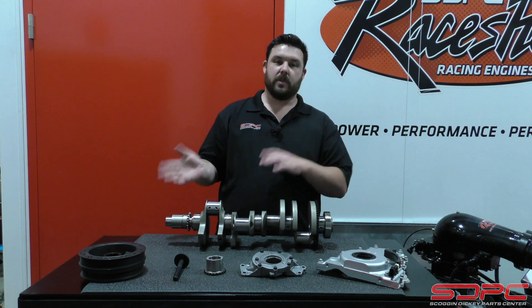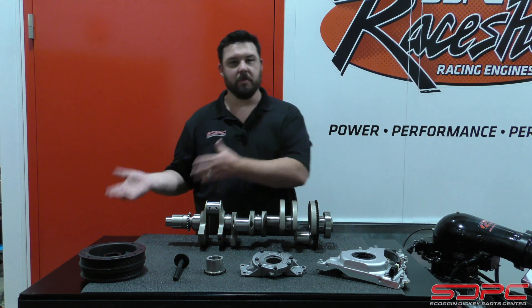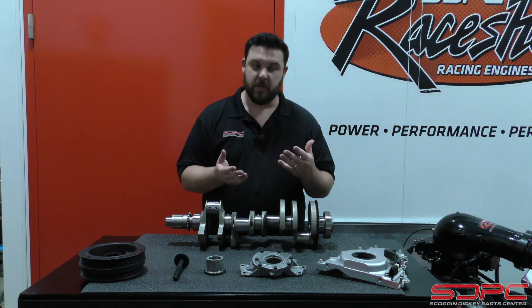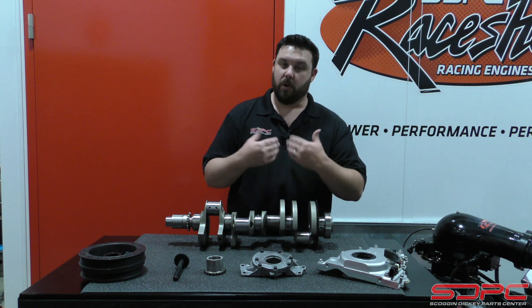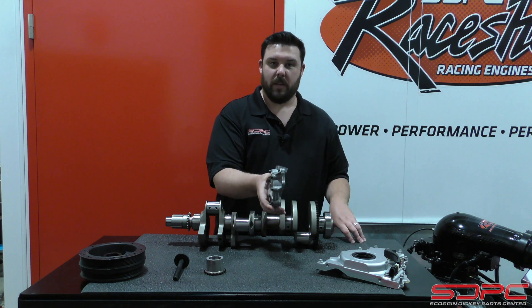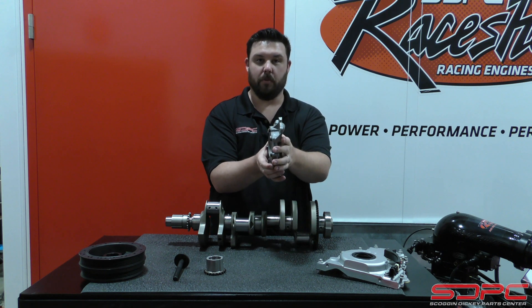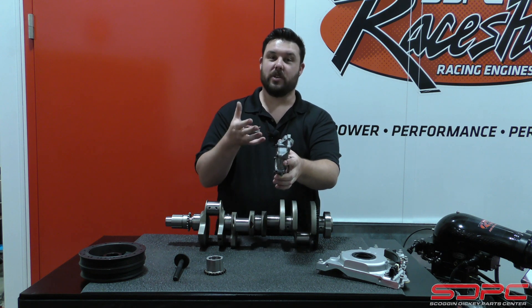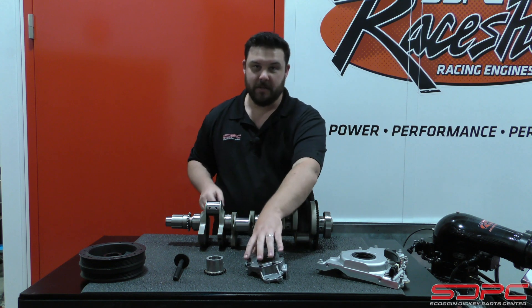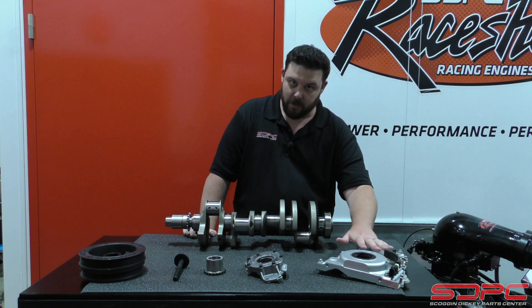The reason you have to remove some of these components is that the block is essentially the same as a wet sump block, even though it was made for a dry sump application. So it's as simple as swapping these parts — take off the dry sump pump, put on a wet sump pump, put on the front cover to match. You'll notice when you take apart that dry sump that the pump itself is almost twice as thick, with one pump for pressure and one for suction sucking it out of the pan at the bottom. To match the thickness of this pump, you also get the front timing cover to keep it lower profile.